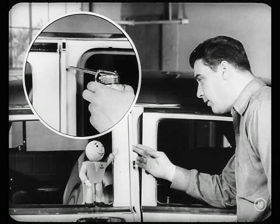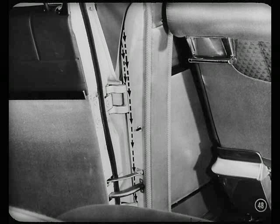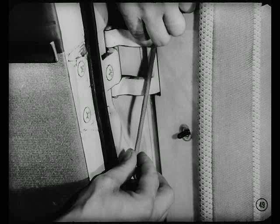That's an unusual case, Jim, but it's easy to correct. I could just flow body sealer behind that extension strip to close up the seam, couldn't I? Yep, that's all you'd have to do there. But there's another sealing point at the hinge openings on that pillar that you ought to check. If water gets by the edge of the door, it will run down the rear face of the pillar and into the openings around the hinges. But this is easy to prevent. Just pack body sealer around the hinge openings. You can do it by moving the door from wide open to half open position as you pack the sealer into place. You don't have to remove the center pillar trim.